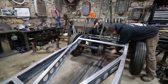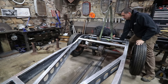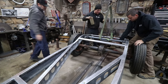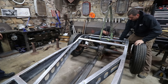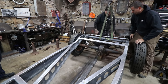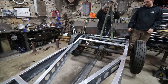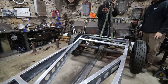The axle's gonna kick. Yeah, I know. I'm just getting it seated. Oh. Put something onto this. Careful if there's blocks of wood, Steve. Yeah. Just for the official tool. It's gonna throw us. Oh, it's looking good. Okay, so now we can... We had this problem on the free tee. The axle wants to kick because there's no wishbone right, or anything. It just levers out. The cheap shackles we had on it actually broke as we were trying to set the rear in the car.